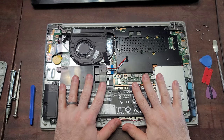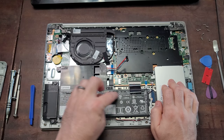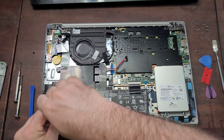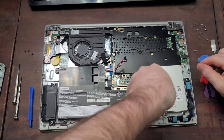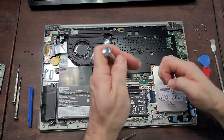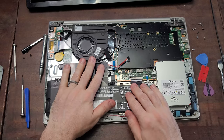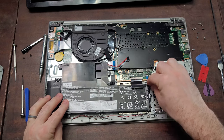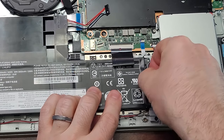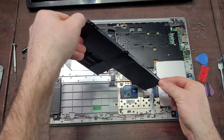We'll just bend those cables over off to the side to get them out of the way. Now, once the laptop battery has been disconnected, we can go to actually removing it from the laptop case. In this particular laptop, it's held down by some screws, so we're going to go ahead and unscrew those one by one. Be sure to keep these screws in a separate location from your case screws because they will be a different size. Make sure that if you are applying pressure, you're not applying too much so that you don't break or crack anything. Always take a look and see what it is that you're pressing down on. Once you've got all the screws taken off, look around and make sure there aren't any other cables holding on to the battery. Here we have what looks like a speaker cable going around, tucked into a little section on the battery. Once you've removed all of those, you can simply lift it up and pull it out.